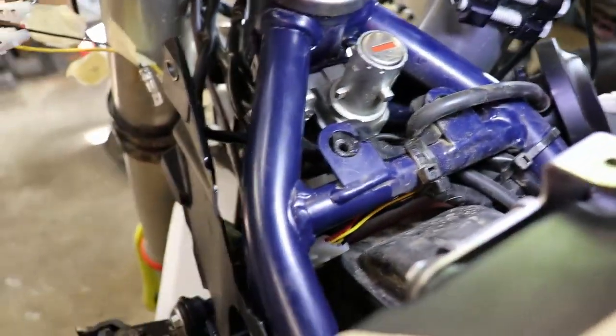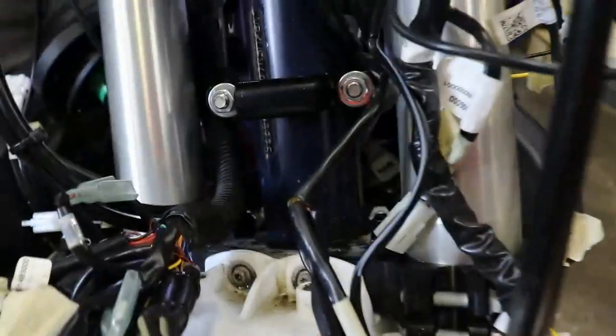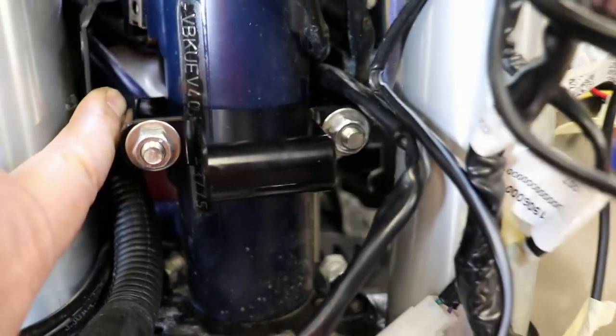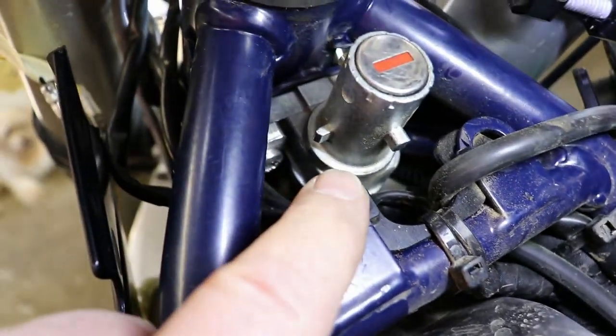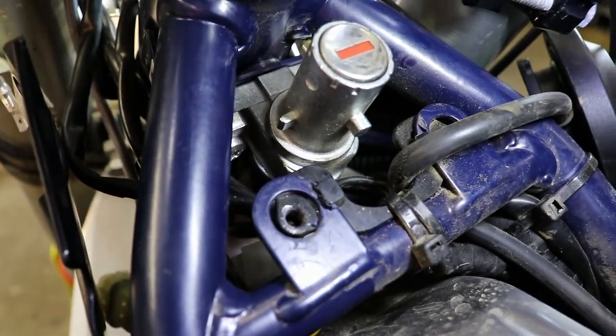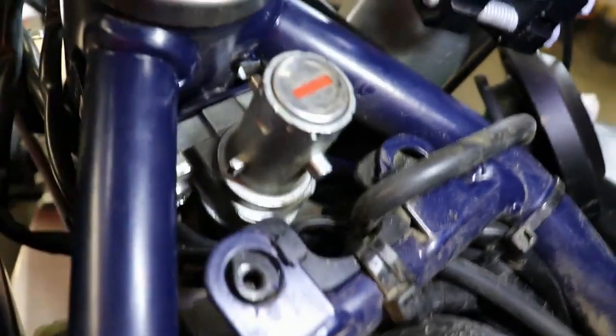Okay, we're up to the section where we're fitting. We've actually put part of the mount on, which is here, which has a U-bolt around the back, it is so simple to do. It just slides around, and it's not a problem. The 2 nuts on that, and that's fixed. Not an issue. The issue you're going to have is the bolts. You have to take the fuel tank off and move it backwards. We found we haven't actually removed the fuel tank totally, which saves us a lot of time.